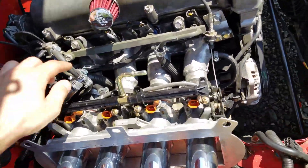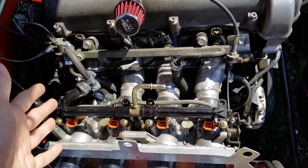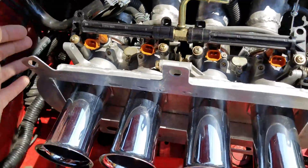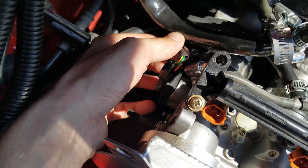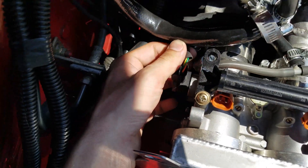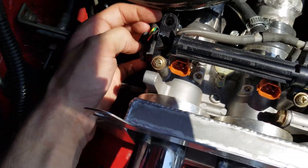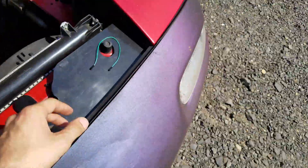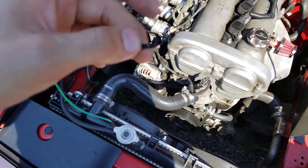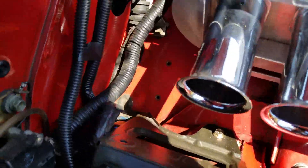Since it's a stock 1.6 Miata intake manifold that they cut, it still has the stock placement for the stock 1.6 fuel rail, the stock injectors, all of those things — stock fuel pressure regulator on the fuel rail as well. It's running a GSX-R TPS on the back of the ITBs where the throttle bodies normally run the TPS, and the way I actually wired up this TPS was with DuPont cables because they plug directly onto the little TPS pins themselves.